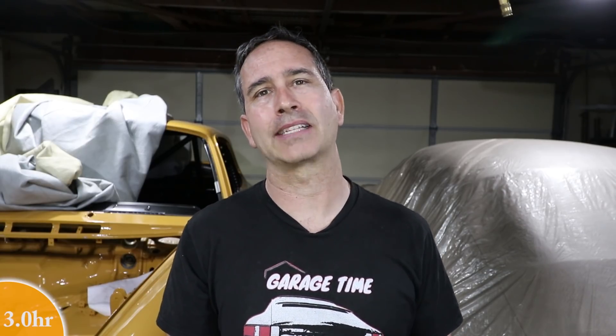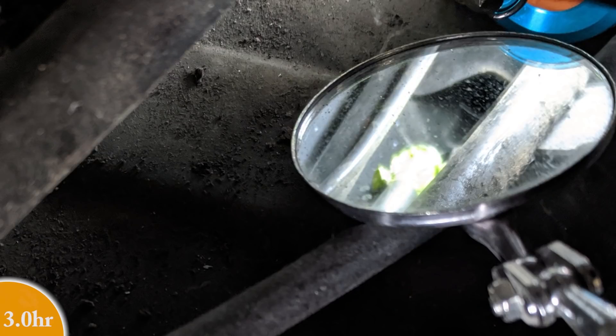I kind of overthought it trying to get that sleeve through the tunnel obstructions. The most simple thing to do is put a ball bearing on the end, tape it on, and just ram it through. You can also put your fingers in the tunnel and lift it past some of the obstacles. The biggest obstacle I found was the seat belt brackets on the inside — they're bulky and a hard stop. Once you get past the seat belt brackets, it really goes in pretty easy.